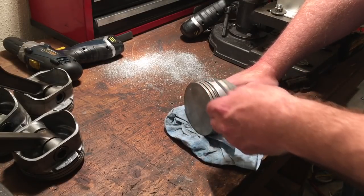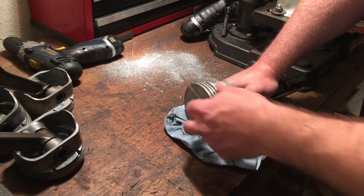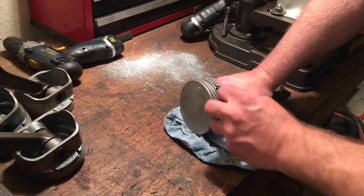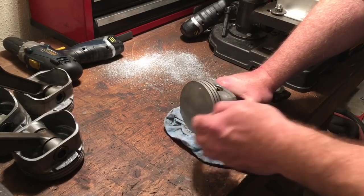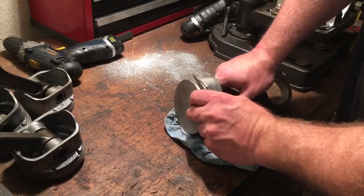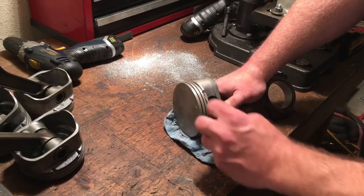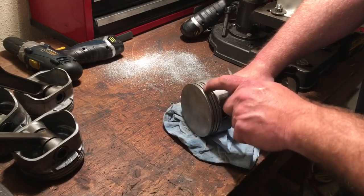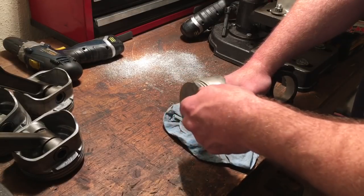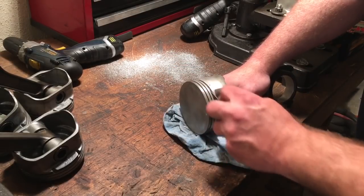If you hit it really hard you may have to do a little more work, but you can still fix it. Just keep in mind, guys — this is not rocket science. If you get a little ding or dent in your piston, file it smooth; it's not the end of the world. These are malleable aluminum pistons, and I guarantee if you saw what they look like and what they went through when they were first being made, you wouldn't hesitate to go around and clean these up and make them work a little bit better than they originally did. Even a random scratch from being handled around the shop — just touch it a couple of times with your file. As long as it's smooth, you're good to run it.